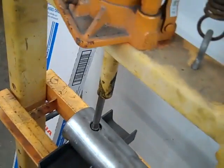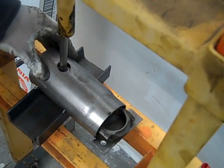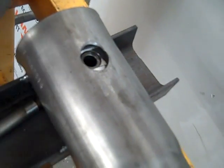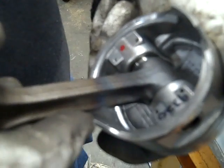It's going to be just a little bit higher than an inch. If you can see down there, we're just going for a little indentation about that far right there. Now we'll back it off, pull our tools out, pull off the press, slide the piston and rod out. What we're looking for is just a nice happy free rod just like that. No magic to that — just go and install it.